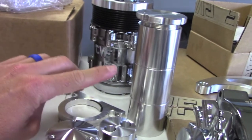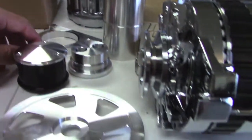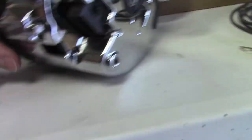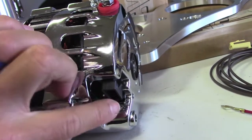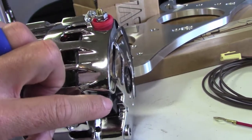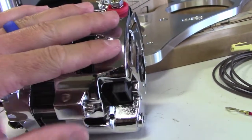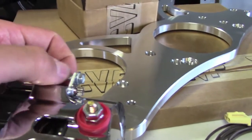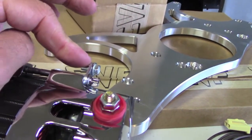I appreciated the guys' expertise. They said a lot of times they end up getting exchanges on the power steering pump when people want the one that's mounted to it — there's just not a lot of room to run your hoses. This is a 160-amp GM alternator in chrome. It's considered a one-wire even though you have these connectors here, but you don't have to use them. Typically you have a charge feed, one that runs from here to the charge post, then an incoming ignition wire, and one that goes out to turn on your amperage light if you're having a problem. But these are internally excited — regulated. So really just run this one to your battery or the common post on your starter, then ground the case. They've even included this nice little tab here. Since the mount bracket is billet aluminum, you're not going to get a good ground where it mounts, so I'll run a ground wire here to the front of the head.